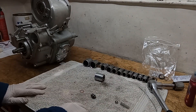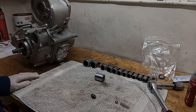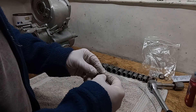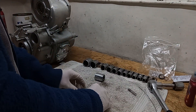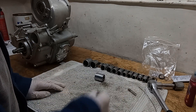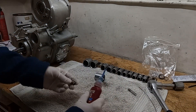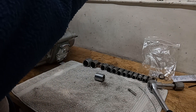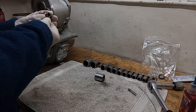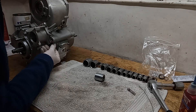For my money that's a lot of faffing about, but you pay your money and take your choice. The owner has decided to fit an anti-drain valve in the tank. What you don't want is two anti-drain valves, so all we do is simply leave the original one out. We've got a new crush washer and we're simply going to put the plug in without the inners - simple as that. People can be as controversial as they like about it, but there'll never be a definitive answer - it's Marmite. You either love the in-tank anti-drain valve as I do, or you hate it.